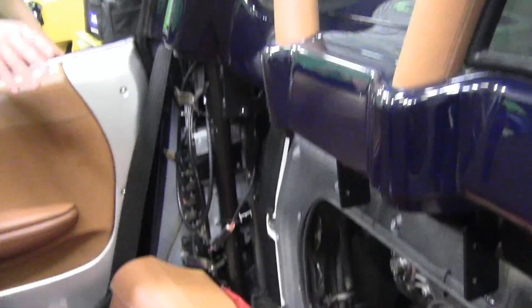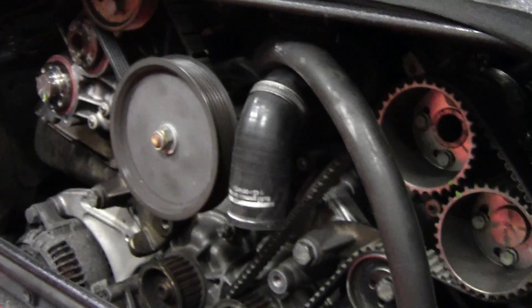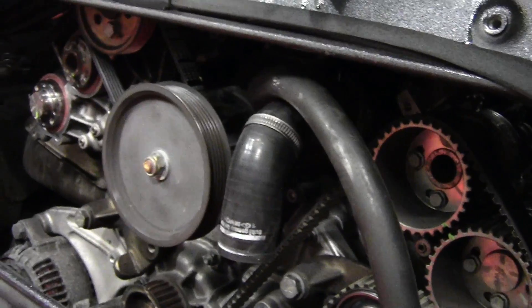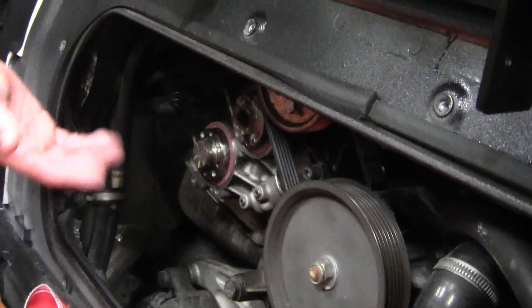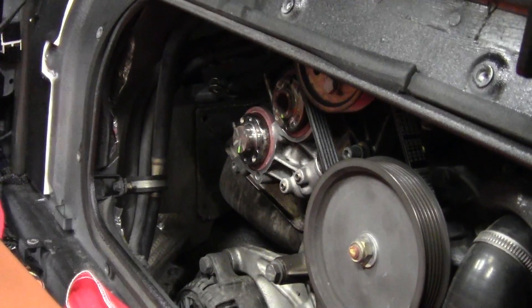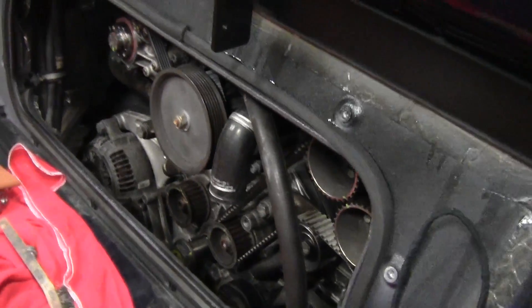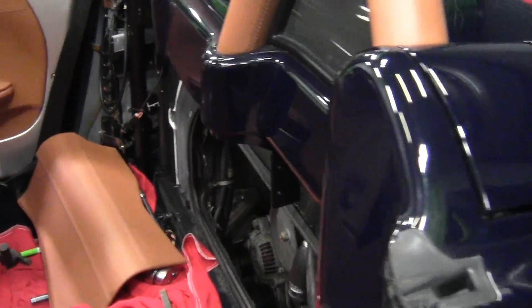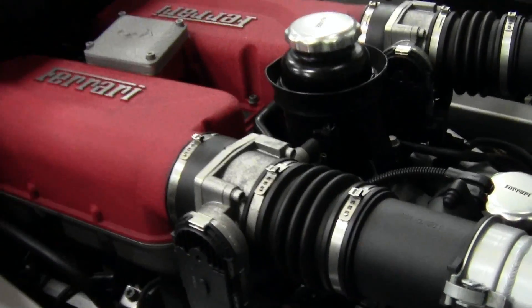Also, I want to show you down here — our cam belts are exposed. This is an access panel, which was one of the biggest improvements for the 360: you no longer have to drop the engine out to do a cam belt service. This is your cam belt right here. You can see we've got the one on the passenger side off getting replaced — it'll get new bearings, new rollers, all of that. The cam covers are actually off as well. We're going to be replacing the cam cover gaskets and the cam seals, as they were both starting to show a little bit of an oil leak.